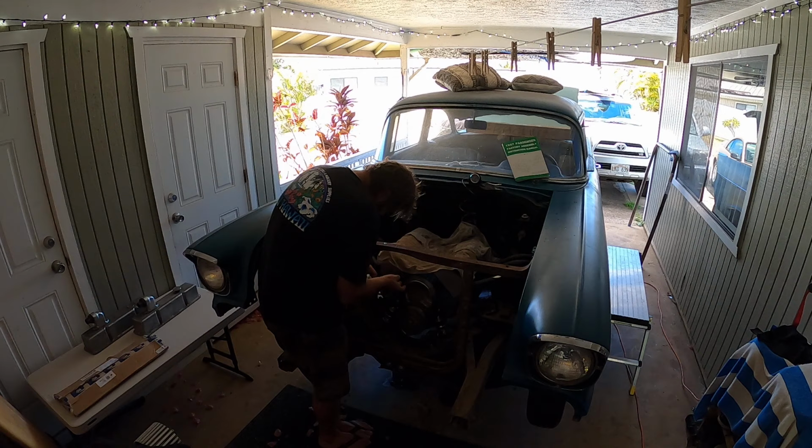And water pumps, especially aluminum stuff, they're dissimilar metals between the steel and the block and the aluminum. And in my mind, they expand and contract at different rates, and potentially while they're coming up to temperature, there's a potential for a leak. I'm probably over worrying about it, but at least that's what I think.